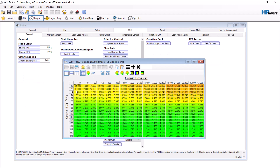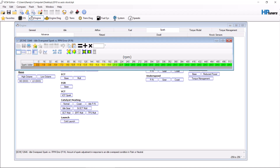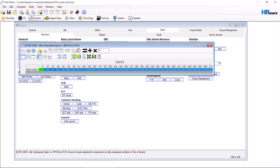From there, your initial idle sound is controlled by the overspeed and underspeed tables. These are limiters that limit the amount of up and down that your idle can do. If you want less of a cam sound, make it negative 5. If you want more of a cam sound, make it negative 35. I always change 0 back to 0. You can do that on park, neutral, and gear — I usually don't change coast. Bumping this up will allow your idle to swing more and give your car more of a chop. If you want more of a sleeper sound, limit the amount of spark it adds or takes away, so it chops faster and smooths out.